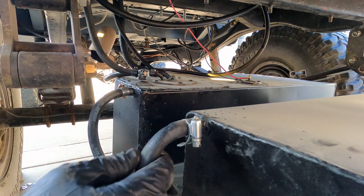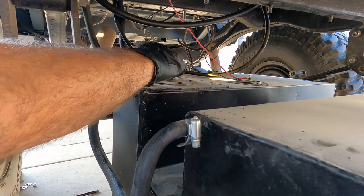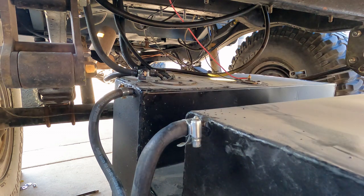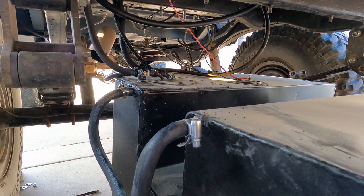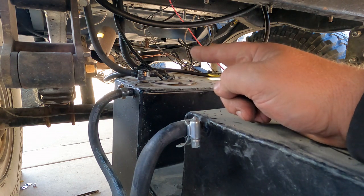It could be our filler neck that's off too, but that's definitely one of our problems right there for sure. I don't see anything major like I was worried about — it leaking at the O-ring or the sending unit. I don't see anything like that, so it's really just that vent hose; the vapors could be coming out of the tank itself. I think we reposition that clamp, maybe even double-clamp it, because I think that's the pressure side I was smelling last time from under the Jeep. We're going to replace this guy for sure and reposition the clamp, then revisit it for smells.